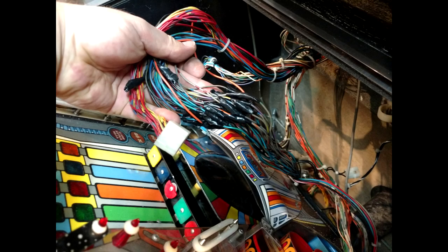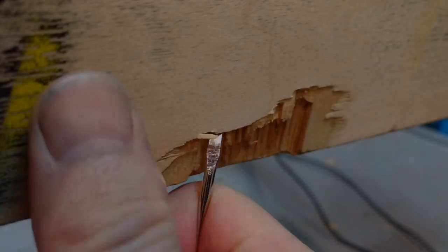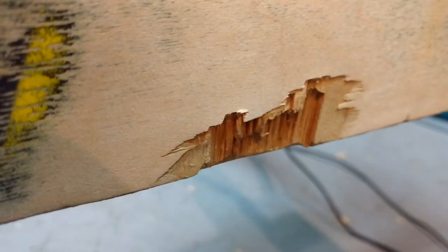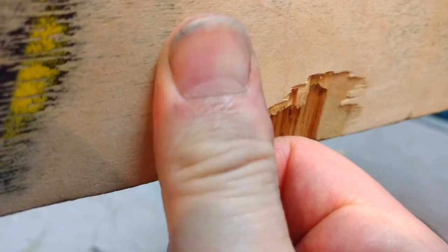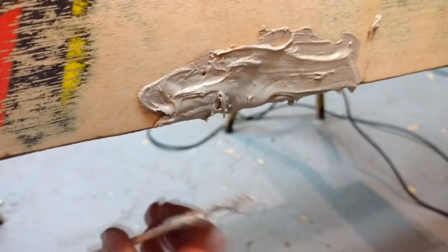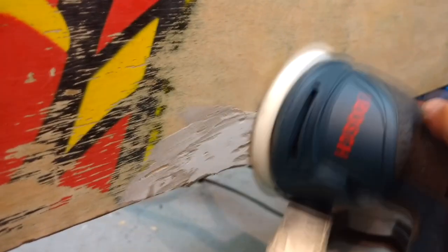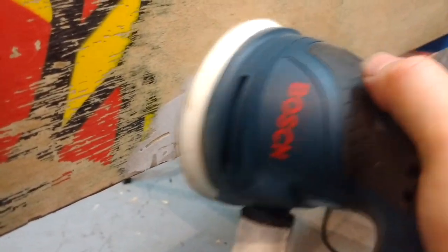The wiring harness had a bit of a problem — someone had snipped it at some point and then everything was all taped together, so I had to redo all of that. The cabinet was in really, really rough shape. It needed to be sanded down entirely — the paint was literally falling off of it. There were a couple of places that were damaged, and there were actually flaws in the wood itself: the plywood layers had big knot holes where you'd have a big section missing in the plies. There was one really bad one on the head where the wood was soft, so I cut that all away and did a Bondo wood fill. A section at the bottom was chipped and I realized it was all empty underneath that top layer, so I chipped all that away, filled it with Bondo, got it all sanded down and cleaned up.